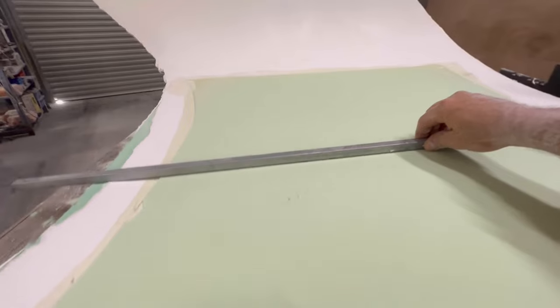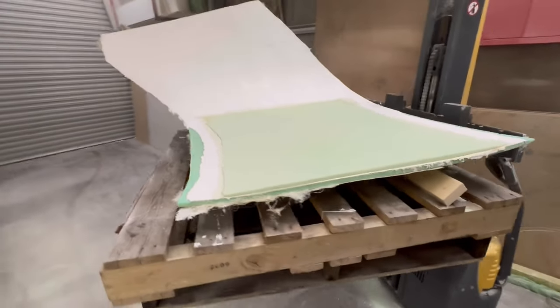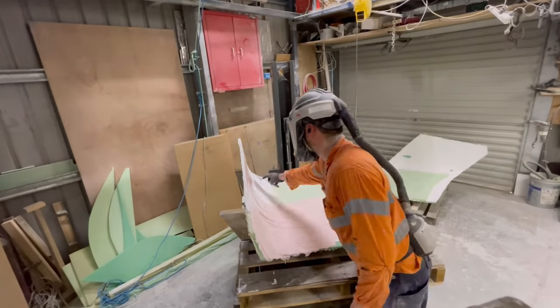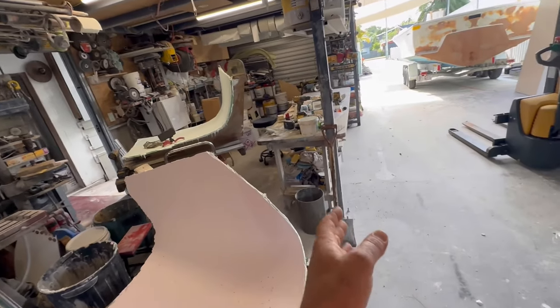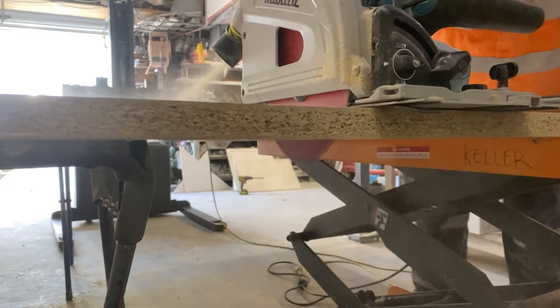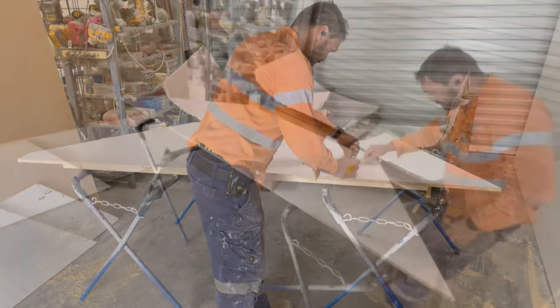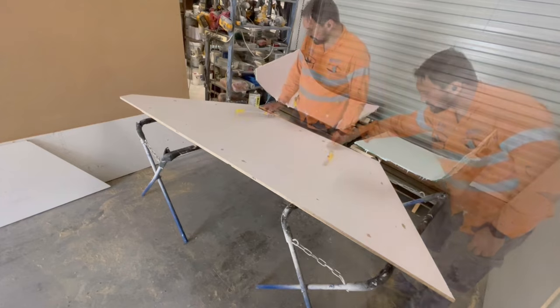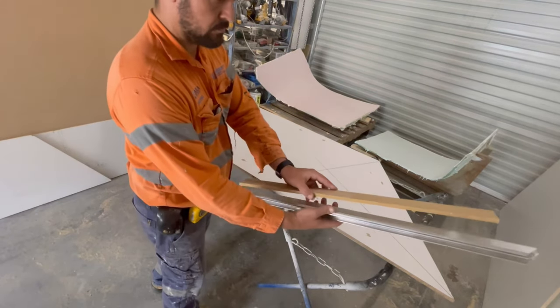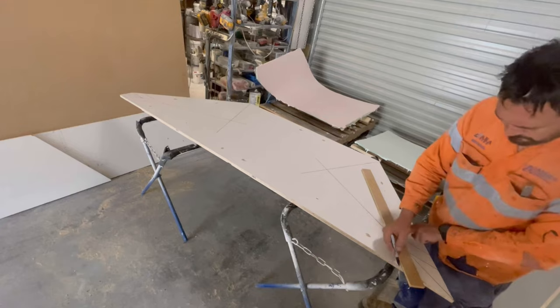It's much better than it was. Okay, that's what I'm going to bog to - hopefully it's the right shape. I've got lots of things going on now: the actuator, the top frame, the hoop, and these things. I need to make the aluminium side window frames. Making a jig made sense - I've never made them before. I make a good line on the centre of each angle. This is where each join will be. I cut a chunk of wood the same size as the frame just to help me mark out where the frame will be.